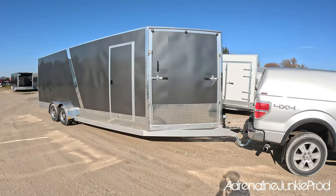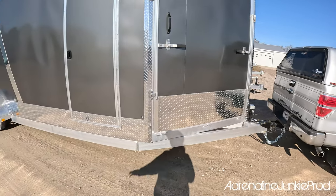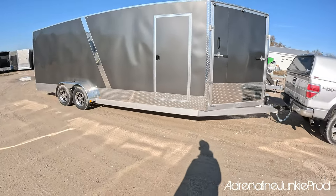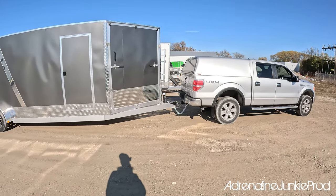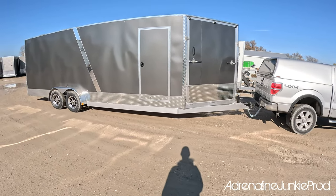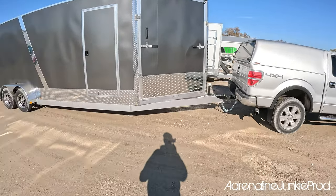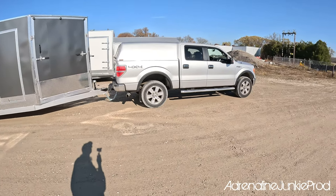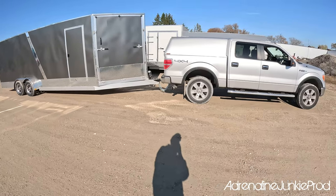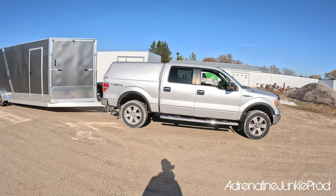It's a nice trailer — weighs about 950 kilograms, so it's not super heavy by any means. It's the first time I've got it hooked up to my truck. The airbags are inflated to about 45 psi and the trailer is sitting a little, not quite as level as it should be, so we're going to have to mess with the hitch. I'm probably going to have to get a slight drop, maybe like an inch and a half. But first, I'm going to load it up with the side-by-side, see how it sits loaded, and then set up the hitch properly, because I want the weight distributed properly and it to handle as good as possible. It is a lot of trailer for my truck.